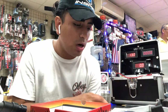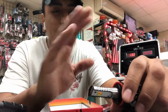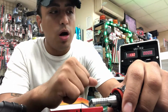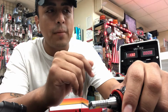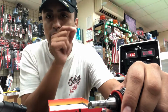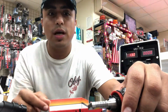So lastly, I'm going to save a little bit of this for the next video, but I'm going to show you guys a CSP chip bulb. This is the new technology being integrated into the bulbs, which is basically a more efficient way to install the light into the circuit board. Previously, with the COBs, with the Cree, with the flip chips, you have an in-between layer from the LED to the circuit board, either an alloy that connects both of them, or another circuit level that connects the wiring together.